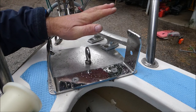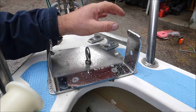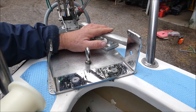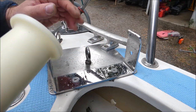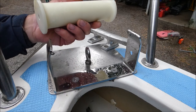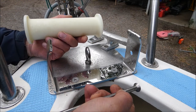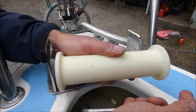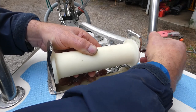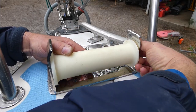We had to change the position of the mooring cleat because there are a lot of clearance issues in terms of getting a big rope over it. We've now got room for an inch and a quarter rope to go over that, which should do most moorings. The anchor winch came with an anchor roller to keep the chain from bashing against the fibreglass and feed the chain and rope into the anchor winch nice and neatly. That's all been bolted on top of the bash plate and it tidies up the nose nice and neatly.